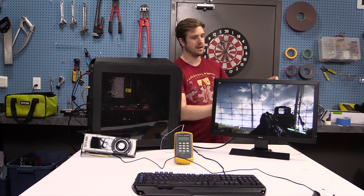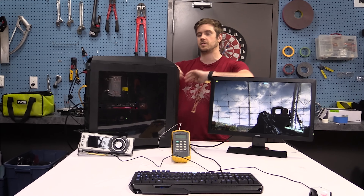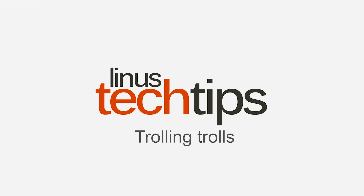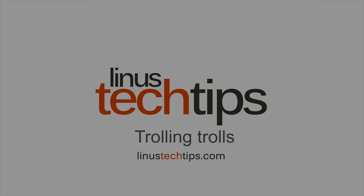We're gonna do a bunch of different scenarios. We have a case that has a basement in it, and we're gonna have the fan going up and down. The clear winner here is probably obvious, but anyways. Without a basement, we will do the power supply fan up and down, and with a reference rear exhaust graphics card and with an internal exhaust graphics card. We're also going to take system temperatures, GPU temperatures, power supply temperatures, and ambient temperatures. Thermometers everywhere — let's get started.